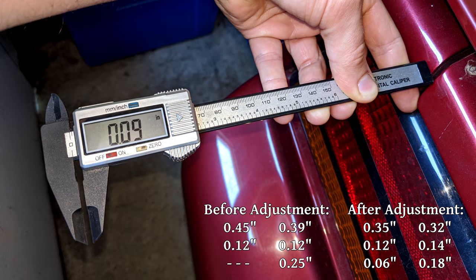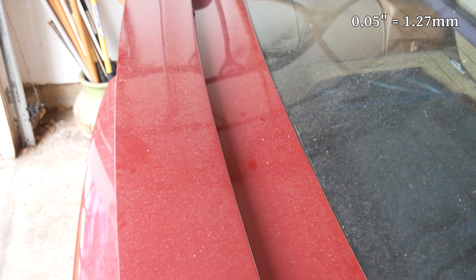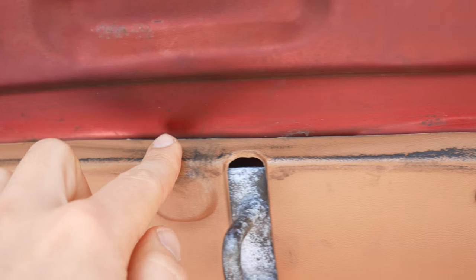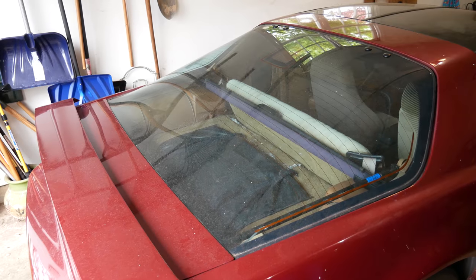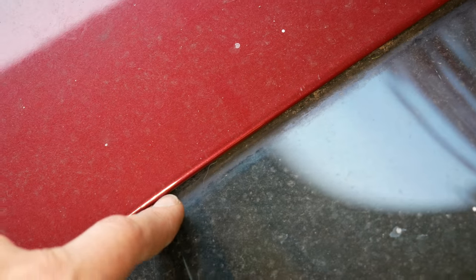Unlike the first time we adjusted the hatch, it's now been two months and it doesn't seem to have moved much. It may have settled a little bit — the driver side now reads 0.09 inches and the passenger side 0.20 — which means we did all that to push the hatch forward around 0.05 inches, less than a sixteenth of an inch. I don't know, it looks a little bit better, and the weather stripping is a little more where it's supposed to be. If it were any farther off we'd probably have to loosen that back deck lid and try to push it forward in roughly the same way we did the top hinge bolts. But at least for now we're going to call that good enough. If we do end up working with this in the future it'll probably be redoing the sealant, but I'm not yet sure it's actually leaking, and I don't want to mess with it if it's not necessary.